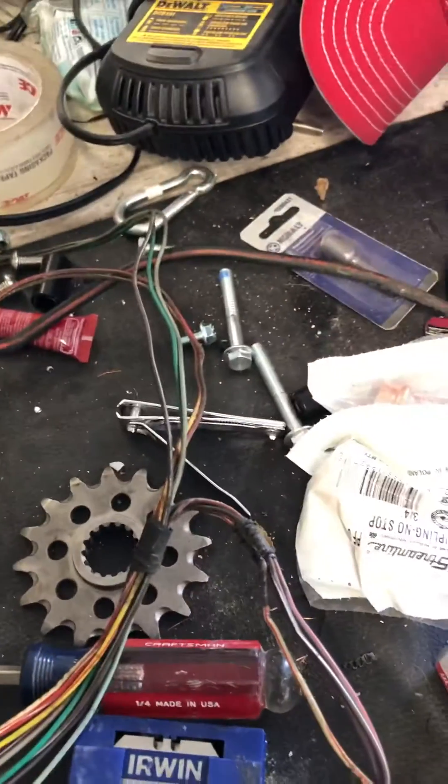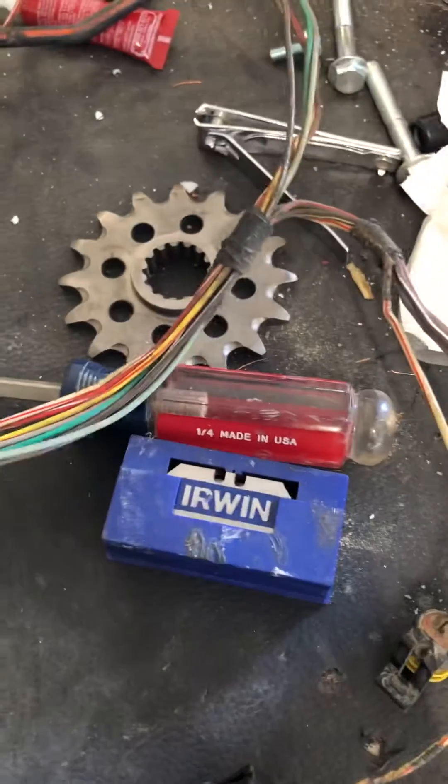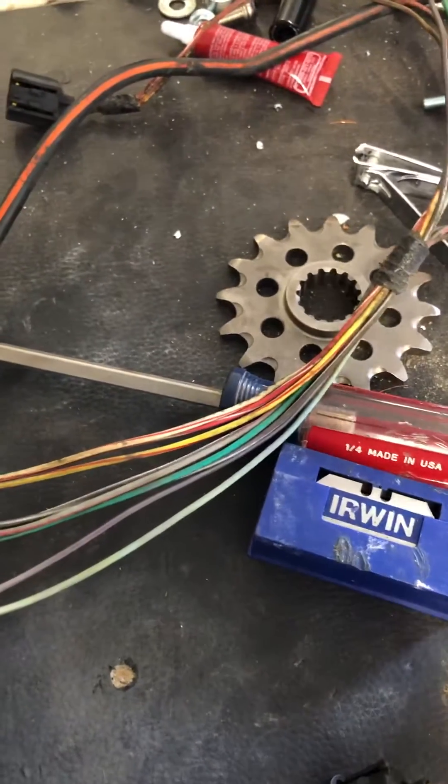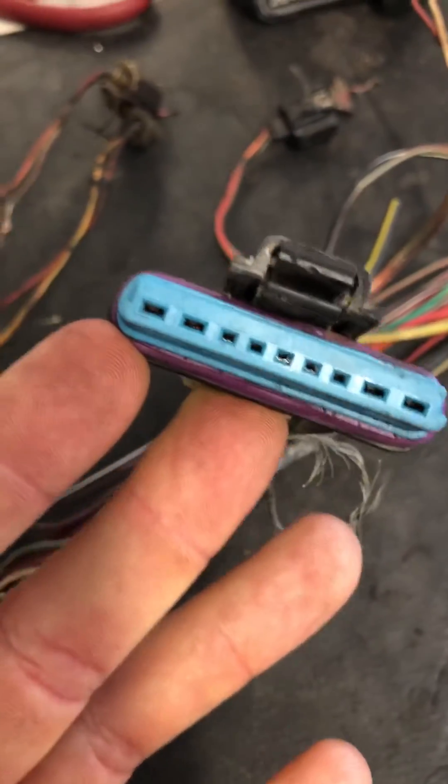I know how to wire stuff — that should be obvious if you've watched any other videos. This is what they look like: they just get corroded over time. This engine's hot as hell, this truck's got 400,000 miles on it. These clips are still in pretty decent shape — we're gonna clean them up and test for continuity. This is another under-hood clip and I am going to replace the under-hood harnesses.